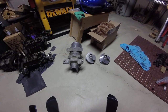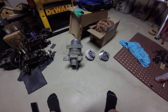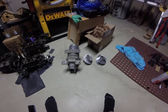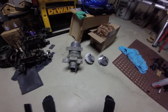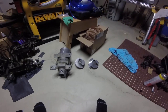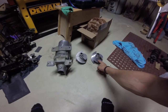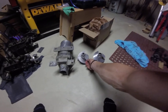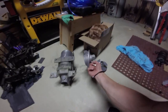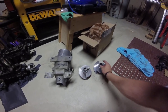And someone that was running a similar setup on a 440 drive line was spinning about 9,000 RPM. So the RPMs go up, you're moving more water. If you're moving more water than you can get into the pump, that's going to cause cavitation. That can be caused by having an impeller pitch that is too low. So let's say the stock impeller, I believe, is a 17 pitch, but it's a piece of garbage because it's cast aluminum and it's thick and it's just not very efficient.